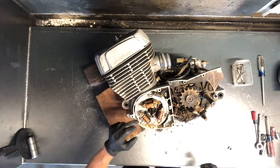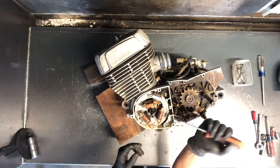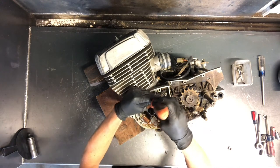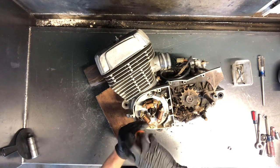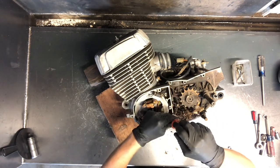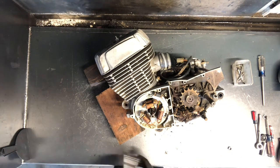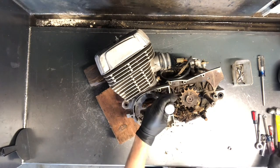Next we've got three Phillips screws to hold the stator on — this is what they call the stator assembly. We'll use a Matco screwdriver with the tip on the end to try to get these smaller screws. This is a number two screwdriver and a lot of times these number two screws can be pulled off with a good high quality screwdriver. All three of these came out pretty easily. We've got a keeper here — that's a larger, number three Phillips, which is where we bring an impact driver in to loosen up.